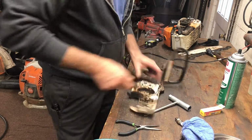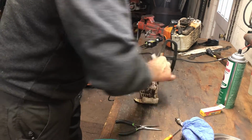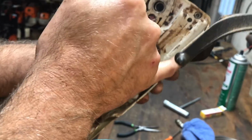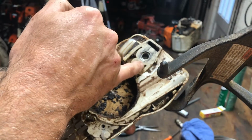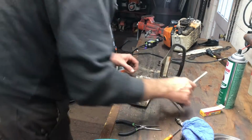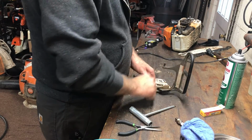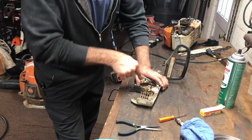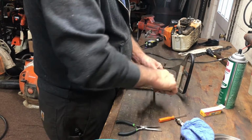All right. Use whatever you can. You want to get this started. There's a lip right there that this dust shield has to come off of, and it's snapped into place. Whoops, let me turn up in here. So I've got this side loose. I'm going to have to pop it out right here and then make sure we go over that tab right there. Usually a smaller screwdriver than a Torx is needed. These are pretty handy. They just seem to give them away, they're 10 cents at my Stihl dealer. There's gobs of them. Just don't get all ham-handed. I know you want to. Just keep working it and it'll come loose.